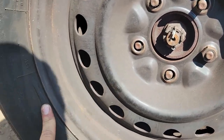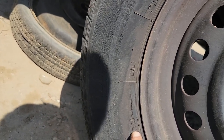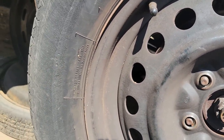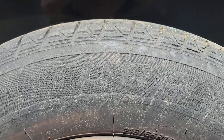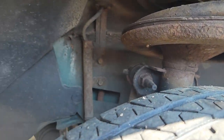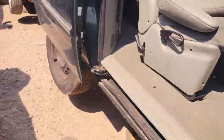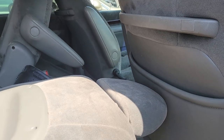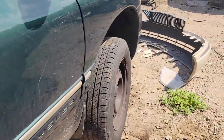There's not much wear on that at all. The tires are pretty old — what's the date on the tire? Holy crap, 35th week of '05. Those are OEM rims. 35th week of '05 is the last time this thing had tires — probably could put it on '06, '07 but not much later than that. Suspension looks original. I was not expecting tires that old on this vehicle. Yeah, this is a low-mile vehicle because they've got lots of tread on them too.